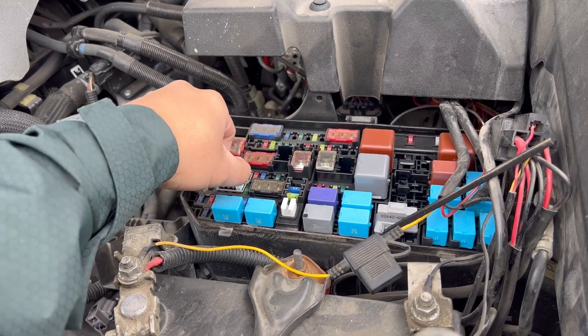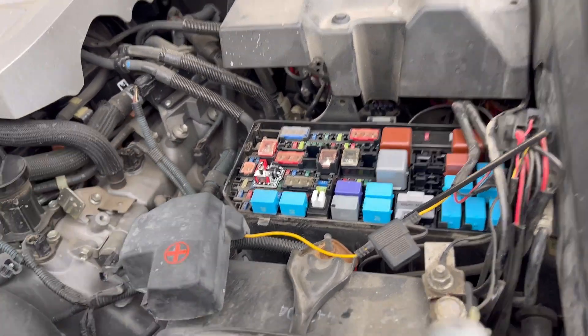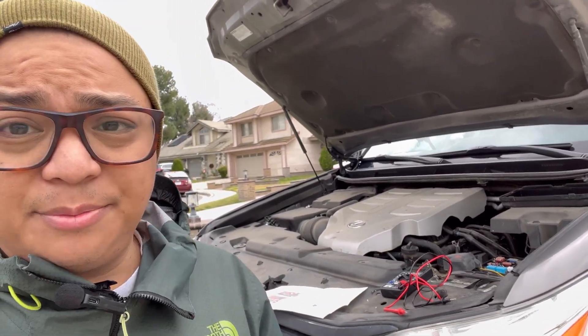I don't want it running constantly on the high setting just to be safe. I know it says AGMs can be charged at that rate, but I don't want to overdo it. So that's it guys — it's very simple. I'm just going to button everything back up. Literally took me about five minutes. The Voltage Booster Pro does include instructions and will tell you the different agreed-upon charge rates. It says 14.5 to 14.8 is what a typical AGM battery would like, so in that case I don't want to set it to high unless I really need to charge up the battery after a deep cycle use — like at camp with the engine off.